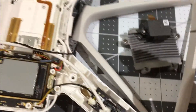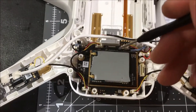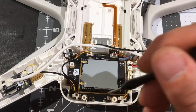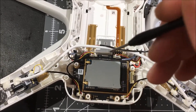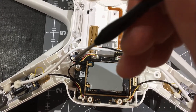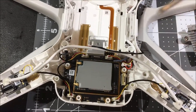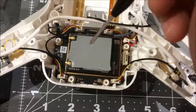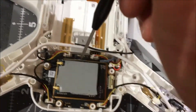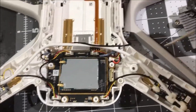Be very careful of the ribbon cable — don't mess that up. Once that's out of the way, you'll see the heatsink sitting on top of the thermal tape, screwed in right here, here, here, and here. These wires and the white one will all be right across it, so you're going to have to pick those out of the grooves on the heatsink and move them out of the way. Once you get it unscrewed, you can pull the heatsink off and just leave the thermal tape — you're going to need that. That is for the heat transfer from the board to the heatsink, so leave that intact.